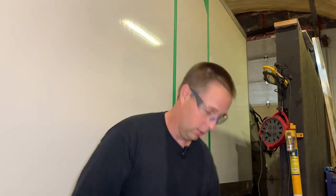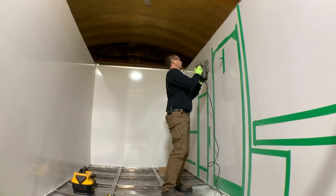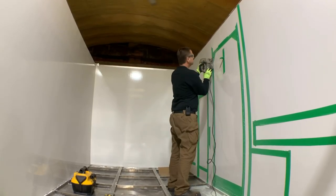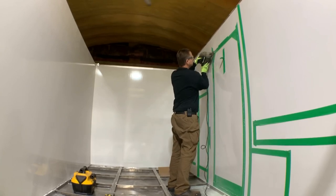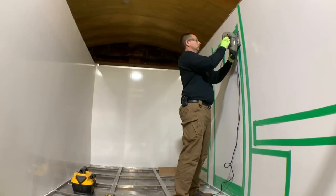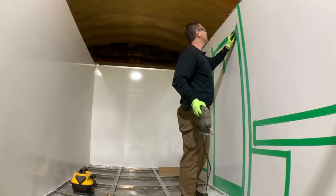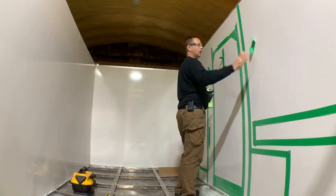That's it for the bottom. I'm about to make a hole in the side of the truck, officially. I'm really taking my time here for two reasons: I don't want the blade to wander between the inside and outside layers, and I don't want to risk the blade pulling the skin away from the core. These are shortcuts I don't need to take.